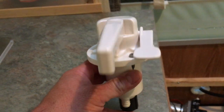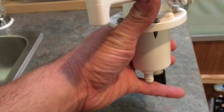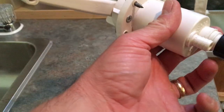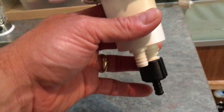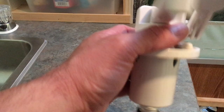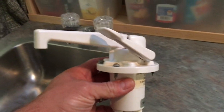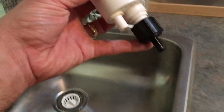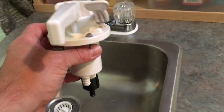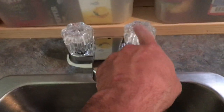When I first installed this I tried to get away with using the existing pump — it handles city connection and hand pumping, but there's air trapped in it to create a vacuum. When I turned on the DC pump, water would just flow right through because there was nothing to stop it. One option was a triple-action pump that allows hand pumping, a city line, and a DC pump — but that's $60 to $70. Instead, for $20 I got a regular faucet: one side for city water, the other side from the DC pump connected to the fresh water tank.